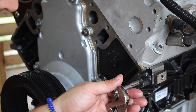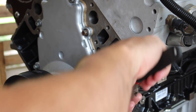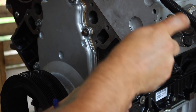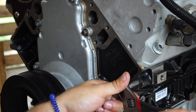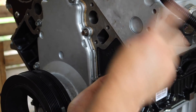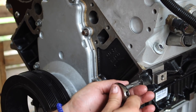You see I have that back and forth motion — that's really key to tapping threads. You can't just keep going; what you're cutting you have to kind of break it off every now and again. Pull the tap all the way out and clean it off, oil it. If you start to feel it stick really hard, don't force it — you're going to break it.